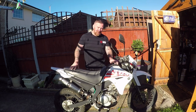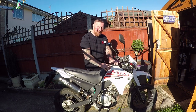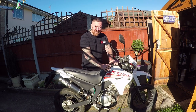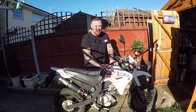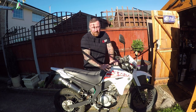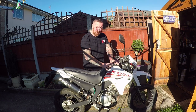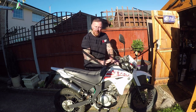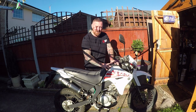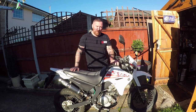So what are you gonna do when you've had a bike that sat outside for 18 months? Fuel - if it's in a garage and it's a big bike, leaving it a while isn't going to cause that many problems, but I'd still drain it out. With these little plastic tanks left outside in the extreme summer we had last year and again this year, the petrol goes stale and goes funny. Drain it out - first thing you need to do is drain the petrol out and out of the carb.